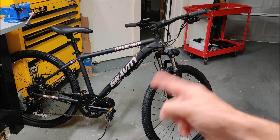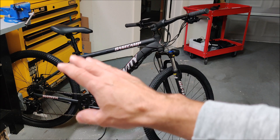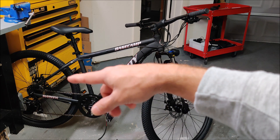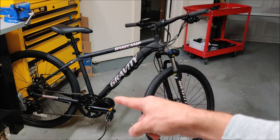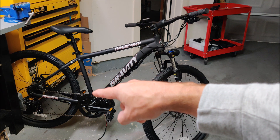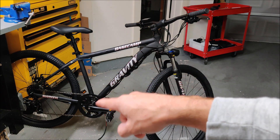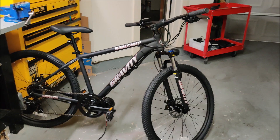On my previous bike I did a rear hub conversion, but then I had to deal with derailleurs, gears, and all of that. With the mid-drive everything just went together nicely. I did remove the middle derailleur — the front derailleur and gear shift are completely gone because this is now a single front cog.